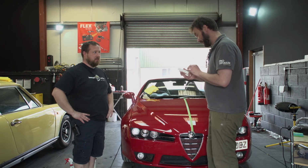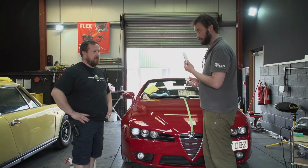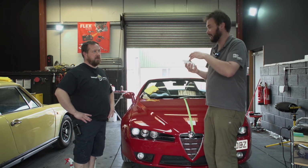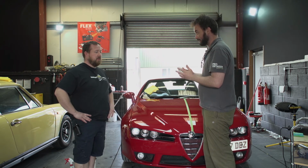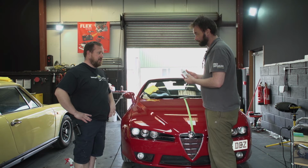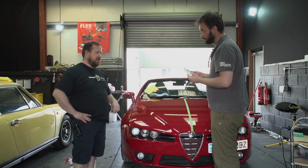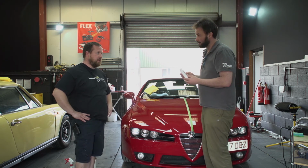Yep. What's interesting you've identified with this is that this stage one can be sprayed on. Yeah, apparently so. Which is interesting, because the last product was obviously, it bonded with the second product that goes on top. Yep. And I think the principle's going to be the same with this one. This isn't a cleaner. Yeah, so it's a pre-glaze that you apply, let it go hazy, and then once it's hazed, you apply the second coat on top. Gotcha. And then leave for 10 and buff.